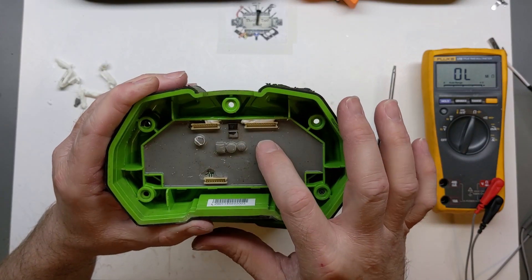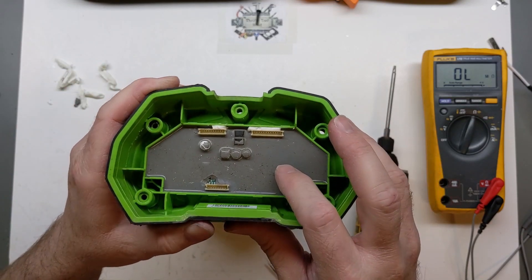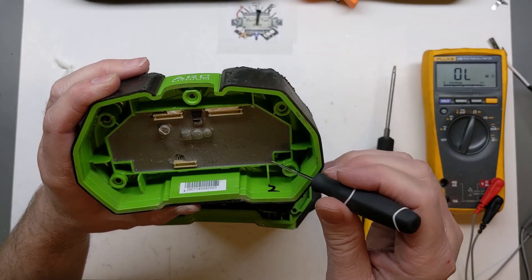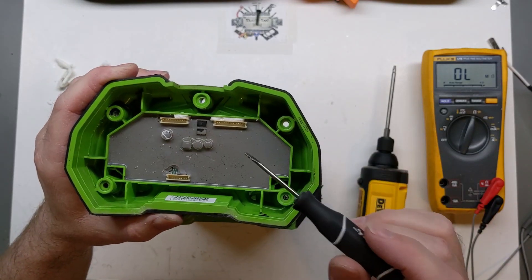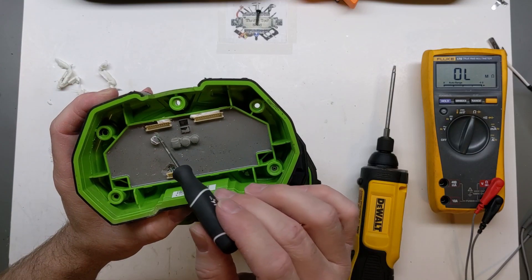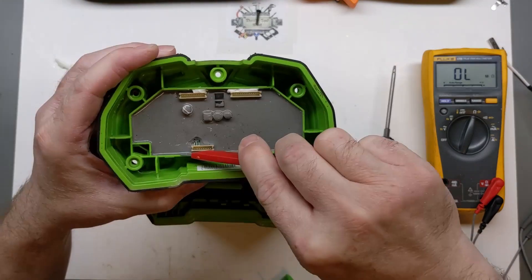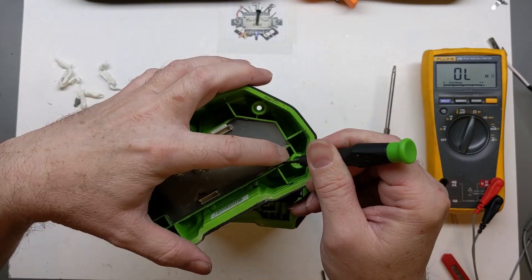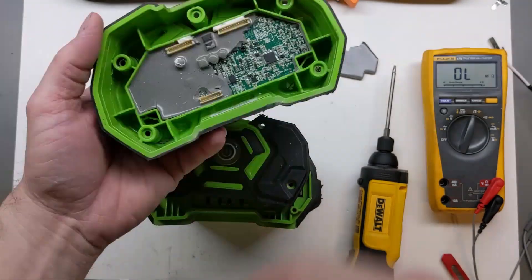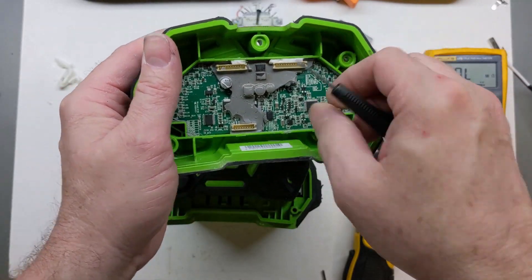The potting is going to have to come off this board. We need to see if we can figure out what's going on with the thermistor circuit, or if it could even be something with the microcontroller itself that thinks it's a temperature issue. I'm going to start lifting the potting just like I've done in previous videos on my 56-volt repair, including this very first repair three years ago. I'll take my razor knife and go around the edge and just start really, really gently picking.